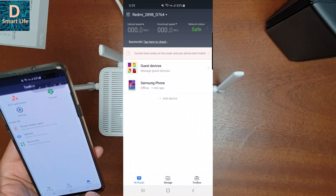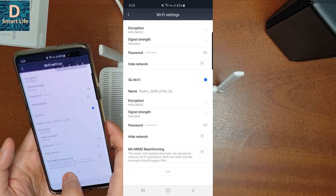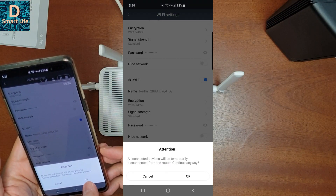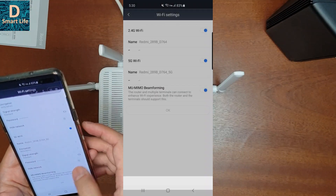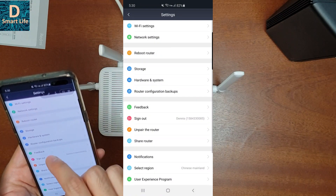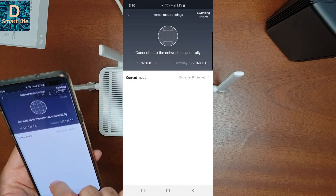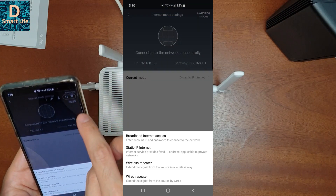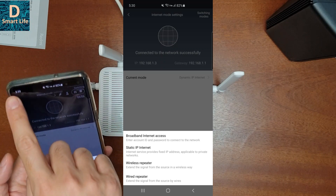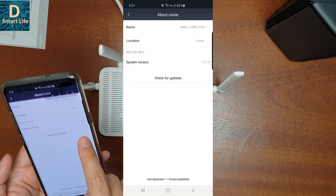Let's check the Wi-Fi signal — it is a Wi-Fi 6 signal. Let's check the other options available. In Wi-Fi settings, you should enable the MU-MIMO technology option for better speed. That is now turned on. You can change the Wi-Fi name and password for both 2.4 GHz and 5 GHz. You can also set the modes and switch between them, enter a static IP address, or set it up as a wireless or wired repeater.